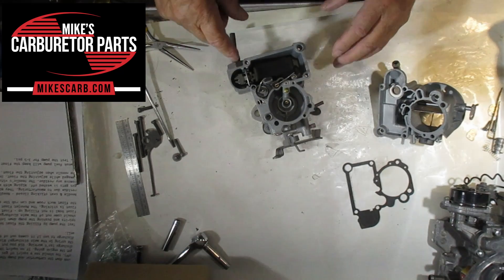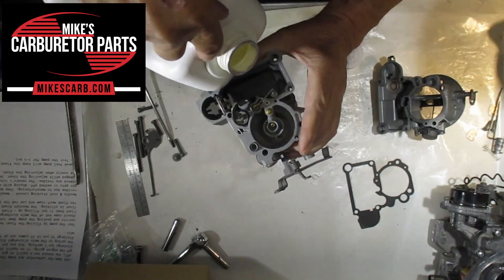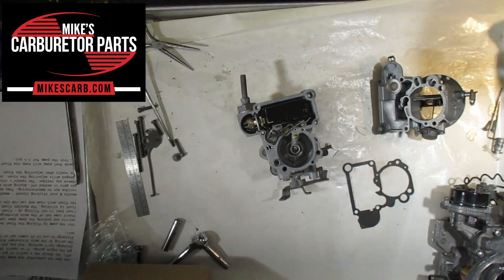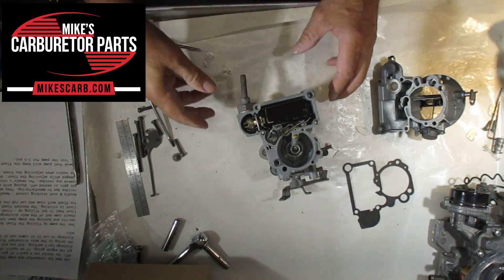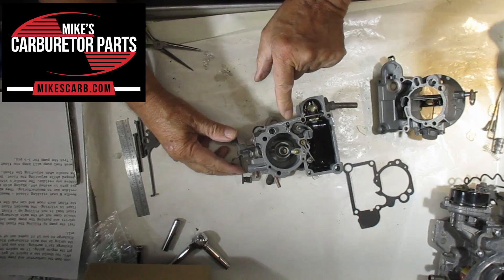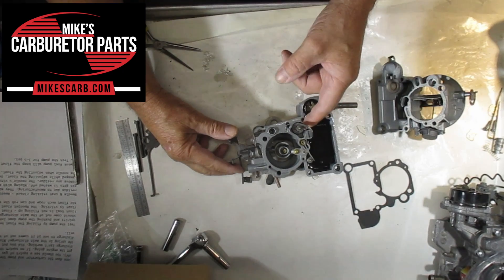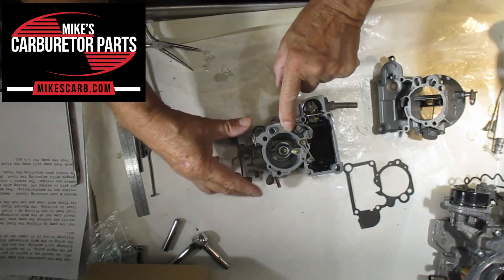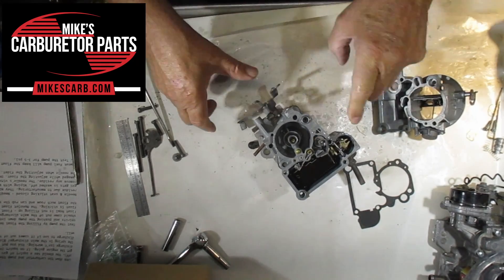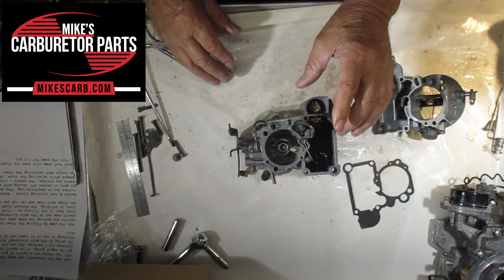If you're wondering whether the accelerator pump is working, we'll test it out by putting a little mineral spirits in here. We may have to pump it once or twice — and already I can see it's working. Gas comes from the accelerator pump when it goes down, and gravity fills up the well as it comes back up. If I plug this off, you can see how it's squirting out — a nice good squirt. That tells me everything is working very well, and that's how you test it once you have everything assembled as it should be.